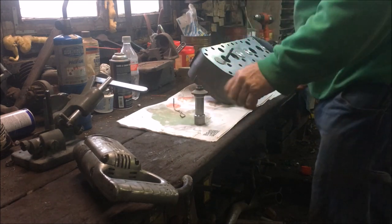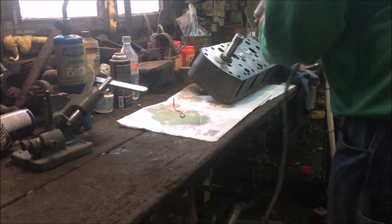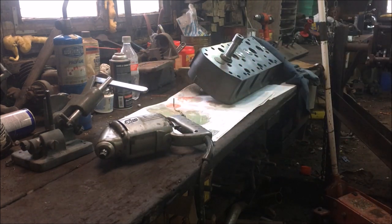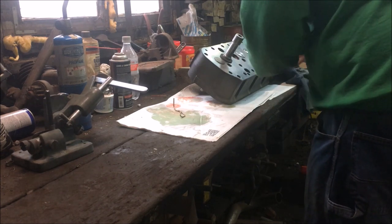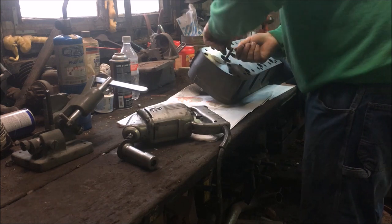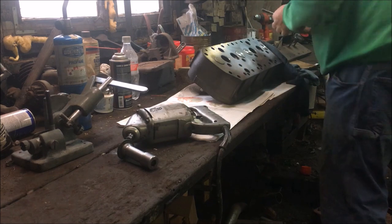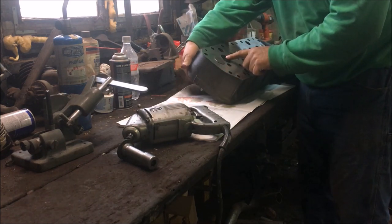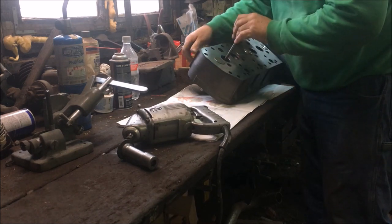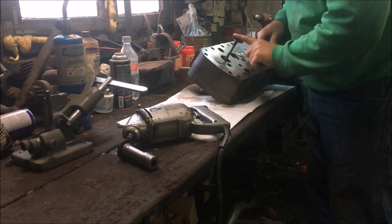I could use a new stone, but I don't use this enough anymore to really warrant that. Oops — came unplugged. I'm going to get another cord. It doesn't look bad — let's go all the way around there. Let's grab the valve and check it out. Okay, that's number one — this is the number one intake. Oh yeah, that's good. That is all it took. Look at the intakes — they're in really good shape on this. It's landing right about where I want it. We'll call that one good.